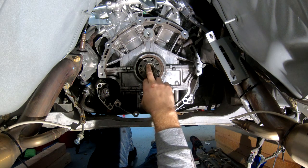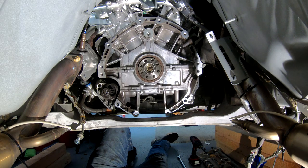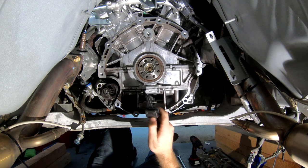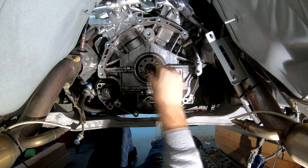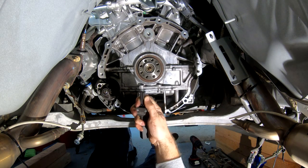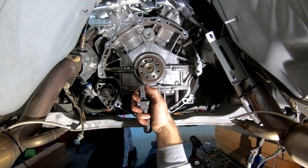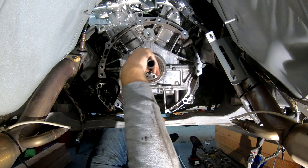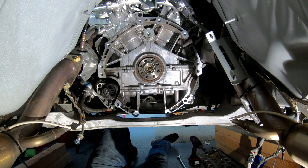I haven't actually seen that trick executed successfully though, so I am going to use a pilot bearing puller which you can rent from a local auto parts store. The problem with this one is I can't actually get it to fit inside that bearing even with it closed all the way, so I'm going to have to modify it a little bit by shaving off some of the lip of the puller to see if I can actually get it to fit in there and then be able to pull it out properly.